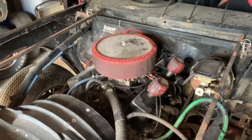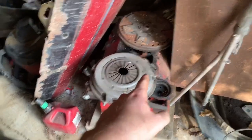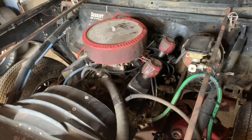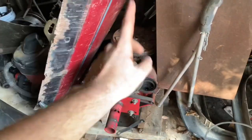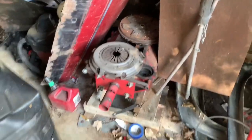And his idea is I could always do what I wanted to do to begin with, the old car. I've got a small block sitting right here that I can build into a short block as a spare motor. So what he was saying is to run this until it quits, or starts showing signs it's about to quit, and then I'll have a short block completely ready. Yeah, that's a 010 casting number, the high nickel. So that's a good block, 4-bolt main.